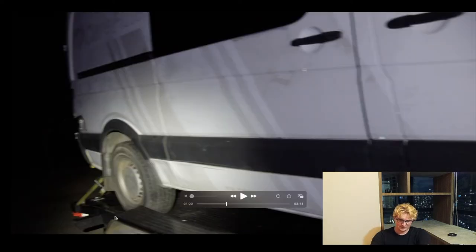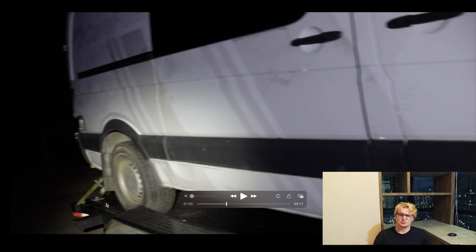It's both safer and far more relaxing towing this thing when you have the shocks compressed. Tip number three: the absolute minimum trailer length you can use for the shortest wheelbase — that is the 144 wheelbase — is an 18 foot. Do not try and utilize those 16 foot U-Haul ones, they are just too short. Ideally, you want a 20 or 22 foot trailer.